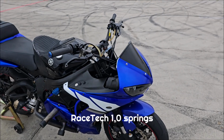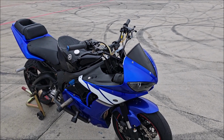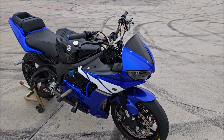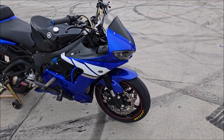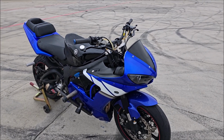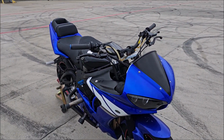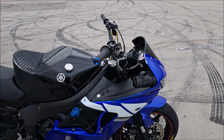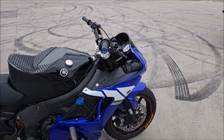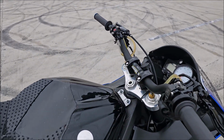I slide those babies in there, and then I put some like 10 weight, just straight weight oil. It just changes the whole dynamic of the bike, the way it feels. You won't be blowing out fork seals anymore, and you can change the spring rate according to your size. So I feel like that's very helpful. They're about 105 bucks online. I can put a link below and help you guys out, but it's just been a really good upgrade on every bike I've done.